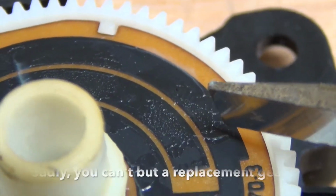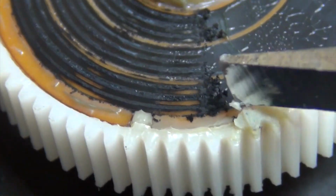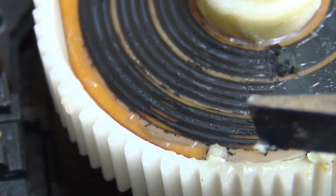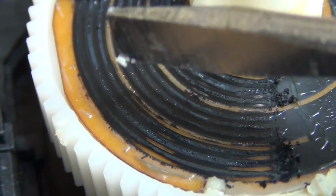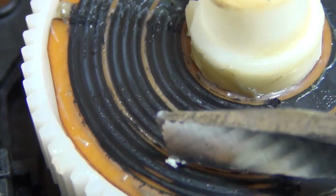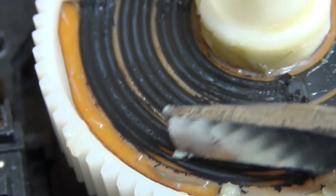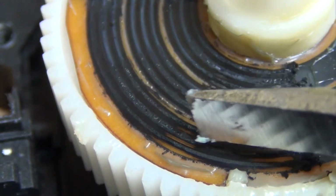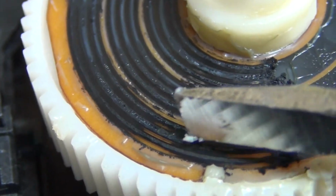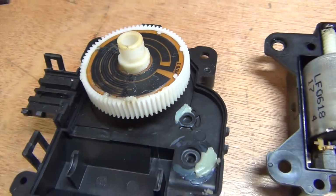because it's worn all the way down through. I mean, this should be solid, like over here, and you can see that there are worn grooves through here. So I'm guessing over time you just wear through and you get these kind of stopping points where the gear is traveling along, all of a sudden it gets to this bare area and the contacts just don't match up, and it kind of squiggles around a little. Maybe it'll work its way into a good spot, then proceed and then stall out again. So guessing that's the root of the problem with that actuator.